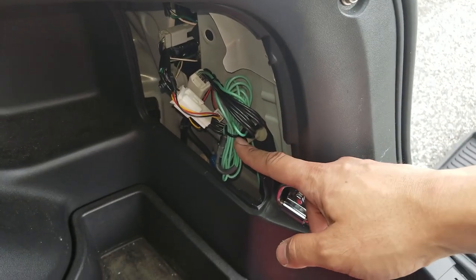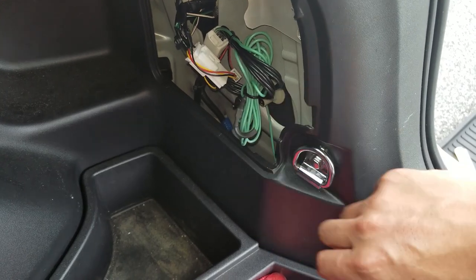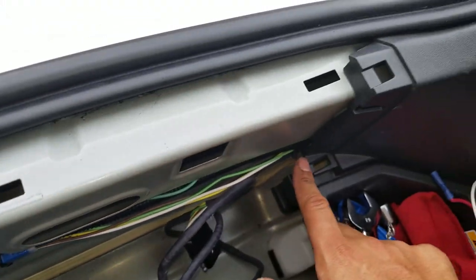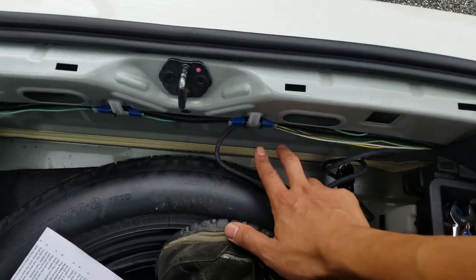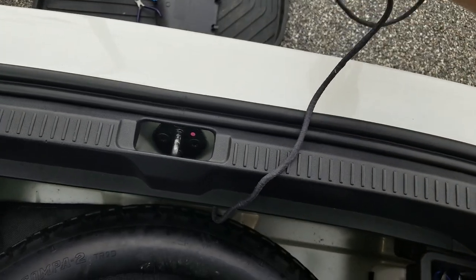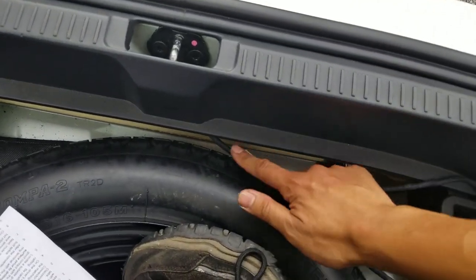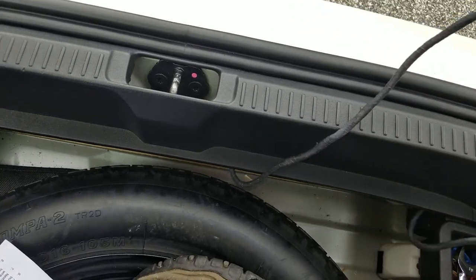I went ahead and removed the paracord and zip tied the excess green wire close to the harness. This way it's easy to get to, and I'll probably take another big zip tie and bundle this all together so it doesn't vibrate. I've put zip ties at several points and left a little bit of slack in case I need to take the box out. When you reinstall this piece — it literally just pops straight down and lifts straight up and off — the connector hangs out the back, you close the trunk on it, and connect your harness to the trailer. When you're not using it, just pull it back in and stick it here. I used two zip ties at that point because this gets pulled on a bit and I want it to be more secure.